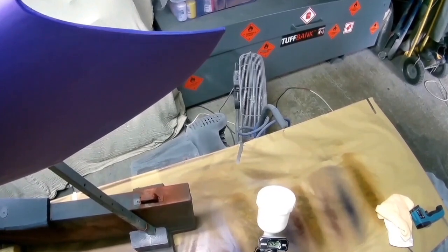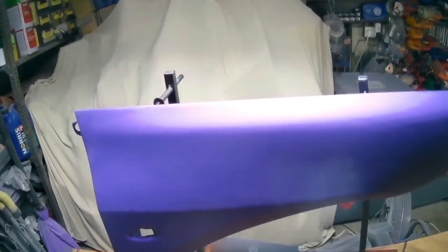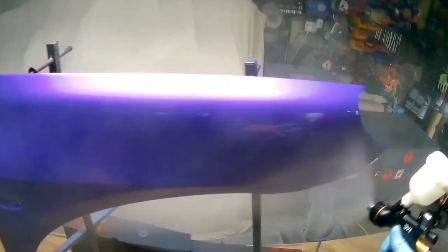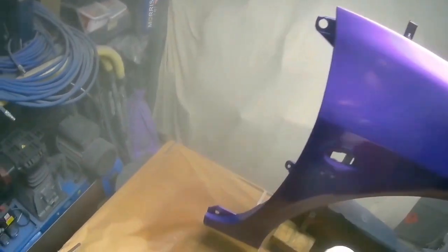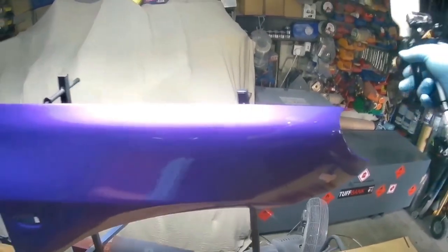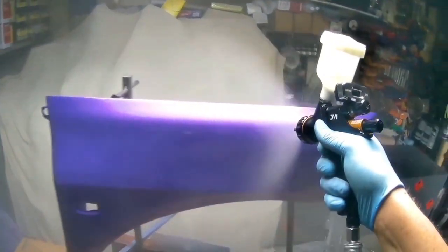It was in fact my favourite clear coat until we got to the warmer weather, when the Cap C took over. It flows really really well - good for the fine atomization of the DV1. You don't have to put loads of material on there. Price-wise in the UK it was around about £99 when I got these kits, looking on eBay the other day they're about £115, but still not that expensive compared to some. The hardener worked really well in the colder conditions. Polishing window - it's not as open as the Cap C, but you'll get a couple of days normally.